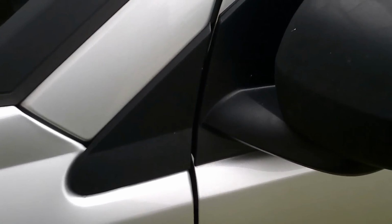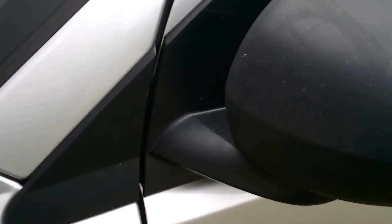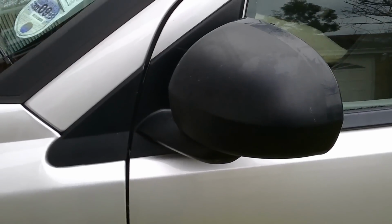So if you get yourself some mastic from a do-it-yourself shop, pull that off, pour the water on there, and have a look from that entry hole that I showed you by the bonnet release catch, and that's where it's coming in. If you seal this bit up with bathroom sealant or something, it costs you about £3 at the very most. That will stop your problem. But make sure that it's all dry first. Before you put your carpets back, test that, and then you should see that the water will stop coming in. That's how you'll solve your problem.